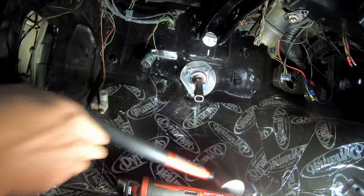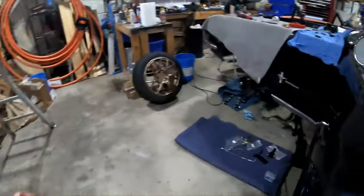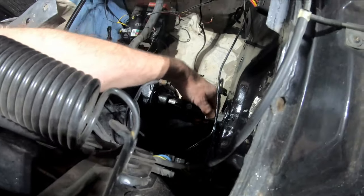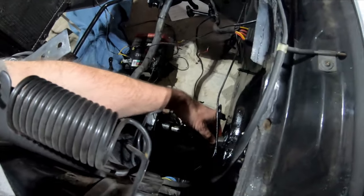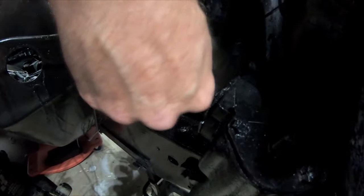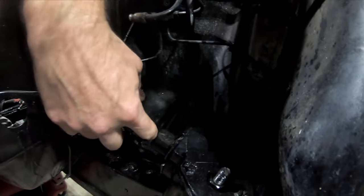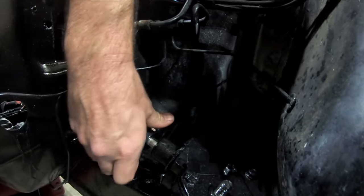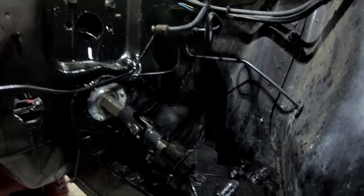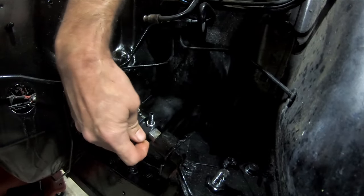So that just popped out of where I had it all lined up, so I've got to go back around. If Caleb was just a little bit older, he could help me line everything up. I think we're going to need two hands for this. Alright, I got that together — it does turn nicely. So this steering box is a 16-to-1 box. I had a 19-to-1 box in here that had the spline fitting. I didn't know if I really needed to go to a 16-to-1, but I do want this car to be a little more tilted towards performance.